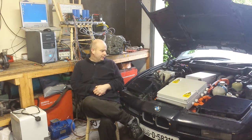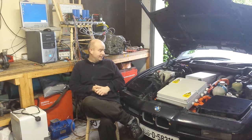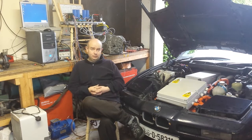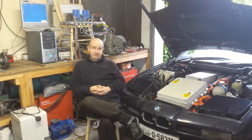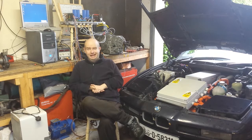Checking around the pump, which is located under the left front headlight, it's basically dead. One of the big problems was that one of the 12 volt feeds to the ABS computer was missing, and I had to chase around some tedious wiring diagrams. I eventually discovered it was a 12 volt feed originally derived from the ECU. Once I had that bypassed, the computer started to work normally.